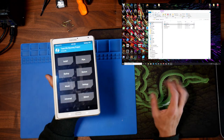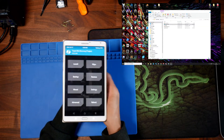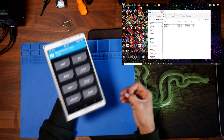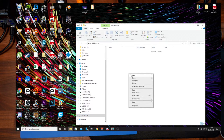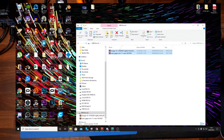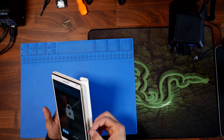Once you've wiped the device, go back and select Install. We need to transfer our Lineage OS and Google Apps onto the device. The easiest way is to put those files onto an SD card. Plug the SD card into the PC, copy the Lineage OS and Google Apps files, go to the SD card, and paste them on.